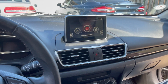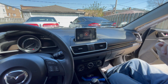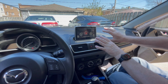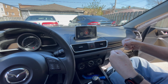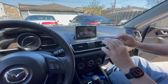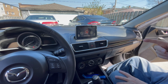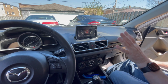Excellent. So obviously the connector, even though I cracked that one piece, I was able to slip it in correctly and push that locking pin back into it. Just take your time. Remember that the crucial thing on that connector that holds the touchscreen display on, you take the little white bar that was there and just slide it back. It looked like it flipped up. I've seen those locking things on connectors. No, this one just slides back and then that ribbon pulls out. Be very careful with those ribbon connectors because they are fragile. Don't bend them, don't fold them, don't yank on them. And just take your time.